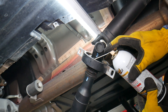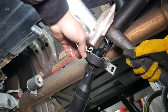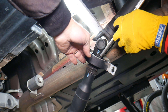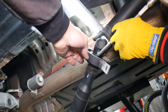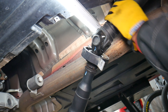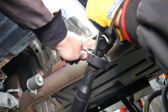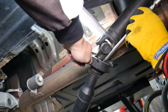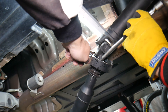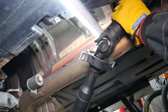We're improvising since we don't have the press tool. We sprayed PB Blaster — it's amazing. I'm holding here and supporting with a hammer and punch on the bearing. It's coming out a little bit. Turn the driveshaft — make sure the emergency brake is off so you can rotate it — to hit a different location on the bearing. Almost out; we can see about 4 millimeters cleared.